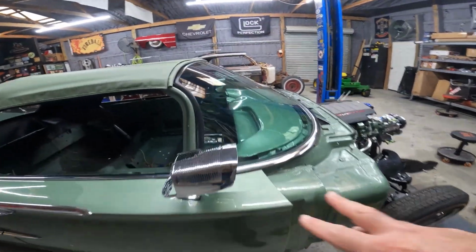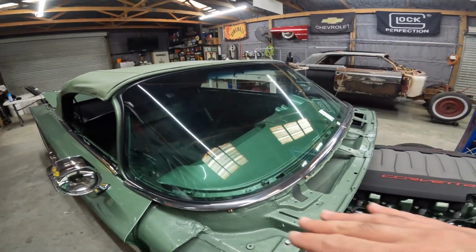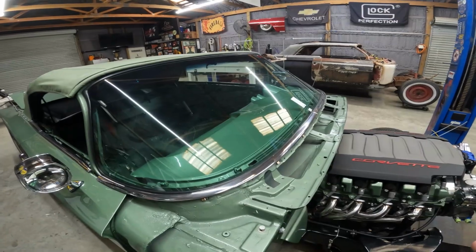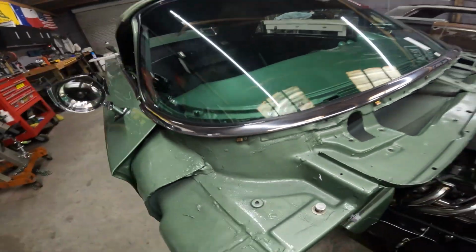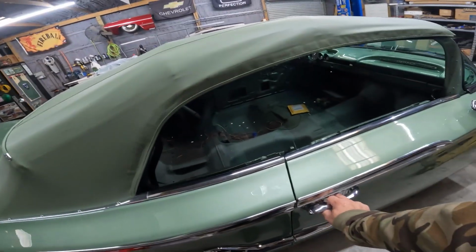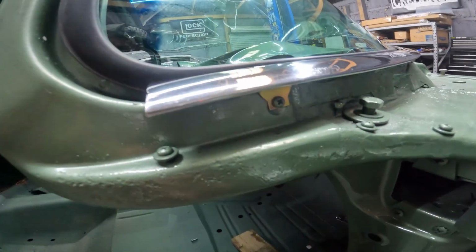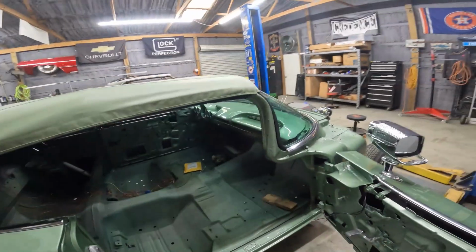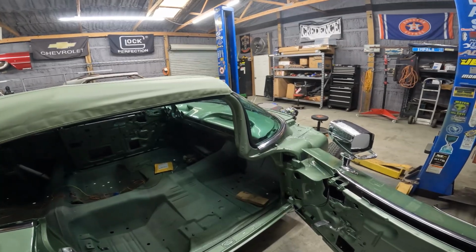During the week, I started putting on the windshield stainless. So the lower's on, that goes first, from my understanding, from what I can tell. I did have to order new clips on eBay. Take note that the clips on the end are different from all the rest. So the two end pieces are different, and that's what I was lacking. That's what I needed. So unfortunately, I had to order a set of clips just to get a couple of them out of there.